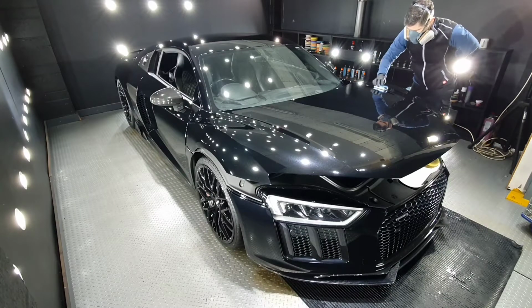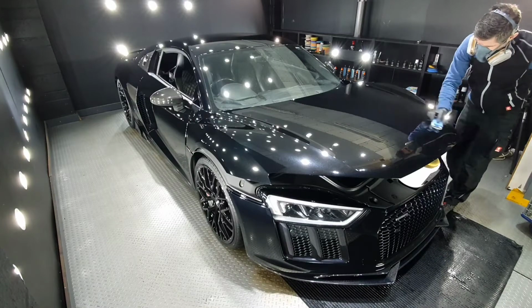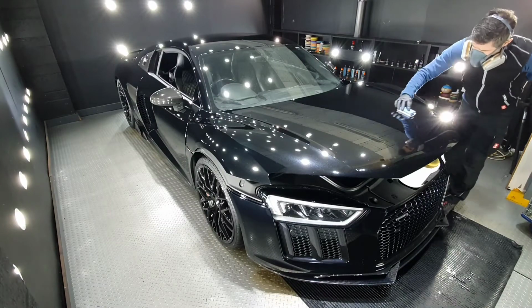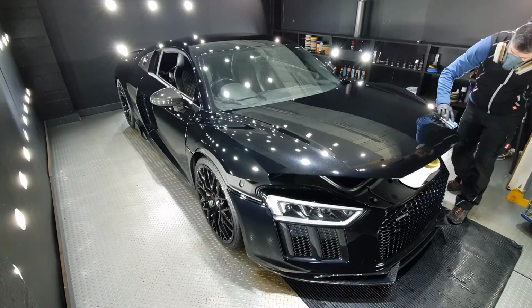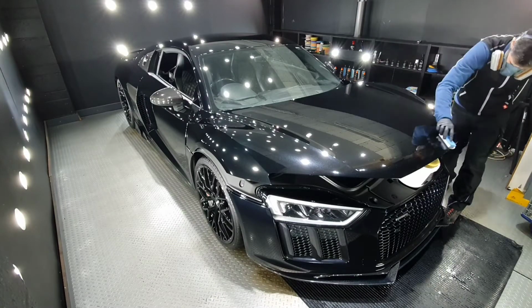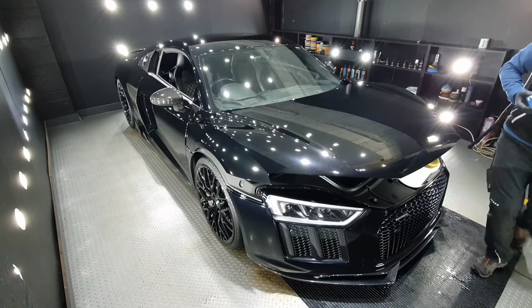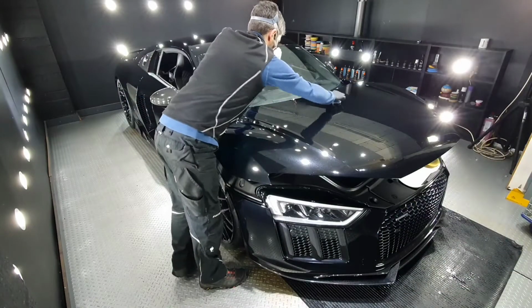Titan is a lovely coating to install. It isn't picky at all. I apply it wet to wet, and you have plenty of time for removal even in hot weather. For a 3-year semi-self-healing coating, it really couldn't be easier to put on.